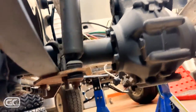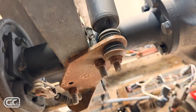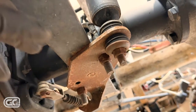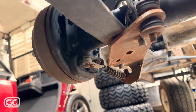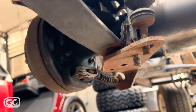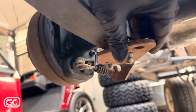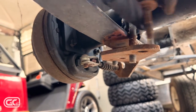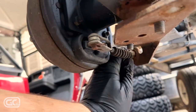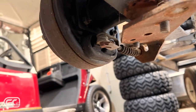Over on the driver's side I'm going to take the two U-bolt nuts off and the shock bolt off to free this up, then work on the leaf spring bolts front and back. Here's the hardware off — it's going to free up the U-bolt and the shock. Keep all your hardware because I don't know exactly what Mad Jacks supplies — the kits can vary from production run to production run. The shock comes out here; I bought new shocks and new leafs for my cart. There's also a brake cable in this retaining plate.